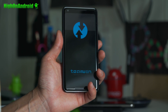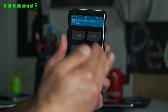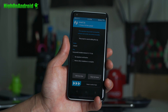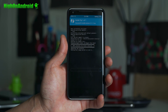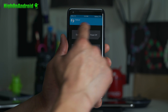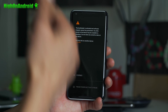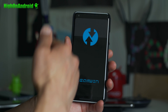First, I'm going to show you how to install TWRP recovery permanently so you never have to use fastboot again. Every time you install a new ROM or new firmware, you'll have to reinstall the TWRP installer — that's because the recovery image is now also part of boot. Go ahead and go to Install and find the file you copied over, the TWRP Pixel 2 installer for your Pixel. Go ahead and confirm to flash. With this installed, now you'll have permanent recovery. Check this by rebooting into TWRP recovery — go to Home, then Reboot, and you get the advanced menu. Hit Recovery. This should reboot you into TWRP recovery. If it does, then now you have TWRP permanently installed. Next time you install a custom ROM, make sure you install this installer after installing the ROM, otherwise you will again lose TWRP recovery.